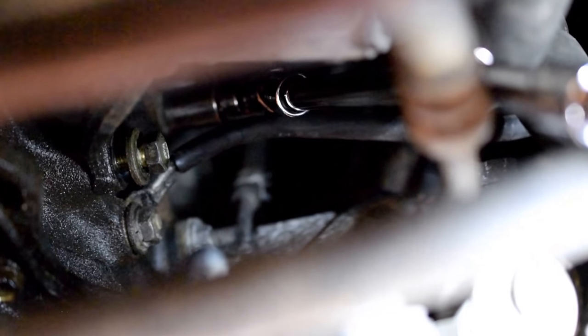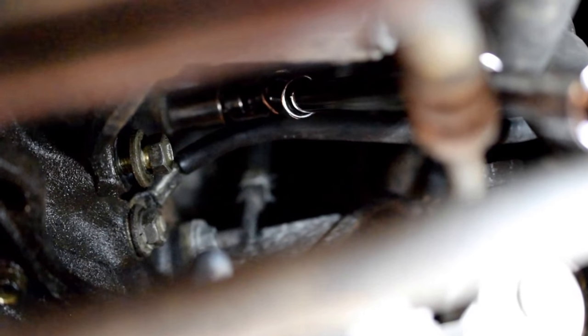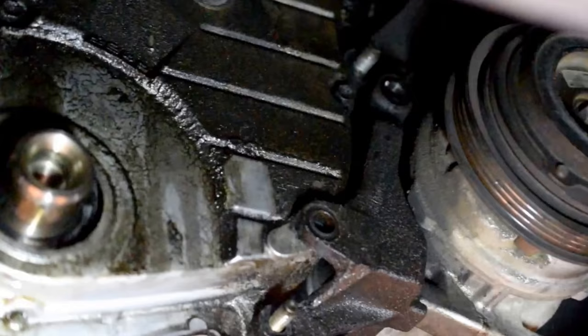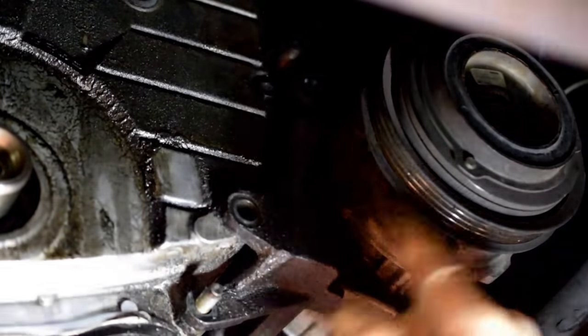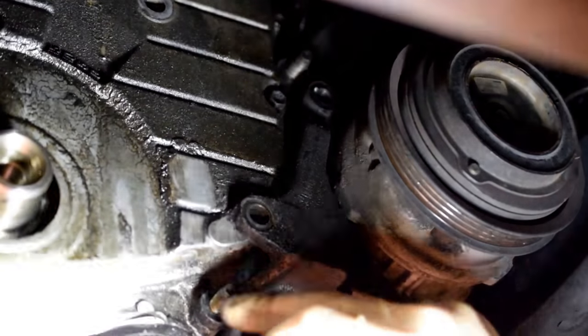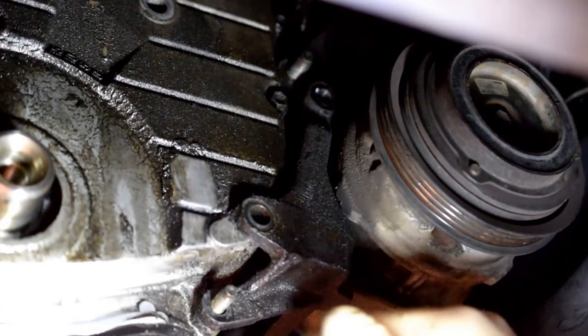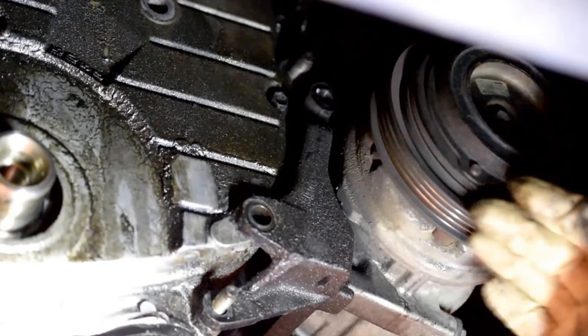To give you an idea of what was required to get the AC bracket — the AC compressor is right above my hand there. This is the bracket that holds the AC compressor on. There are two bolts on the side of the bracket required to at least loosen so that you can move the bracket to get clearance for the timing cover. It took one U-joint and then a couple of wobble extensions. The bracket is in the way; it needs to come off these studs. So you undo the side mount bolts on the back of the block, and then the AC compressor can just hang there while we take care of this.